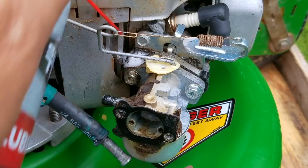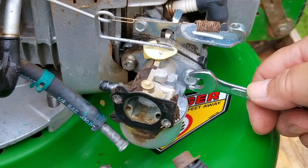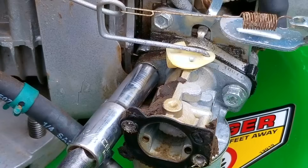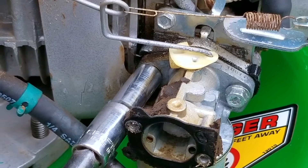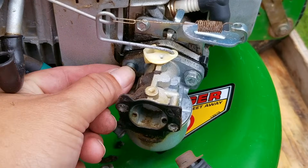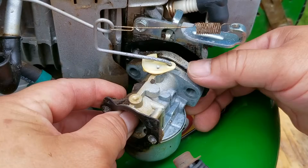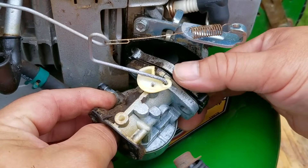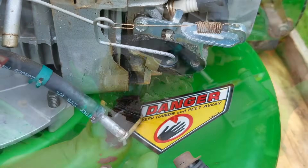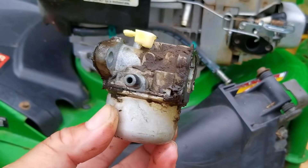On this particular style of carb, the bolts that hold the carb to the engine can be difficult to take off. I would advise you to use something to help break them loose and also take your time, otherwise you could break the heads off the bolts. If that should happen, you might have to drill the bolts out, or try using a bolt extractor. I think the main reason the bolts are tough to remove is because the threads are exposed to the elements, which could cause some corrosion. Once the carb is off the engine, we want to be careful not to lose any of the fuel from inside the carb, because we want to collect it and inspect it for any issues.